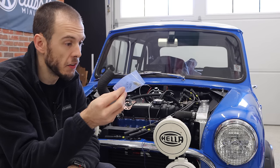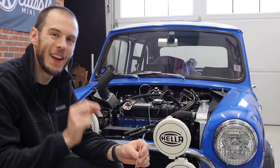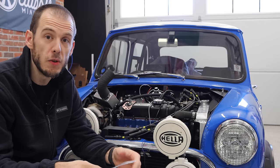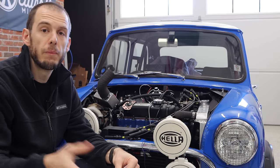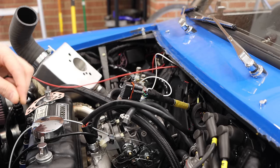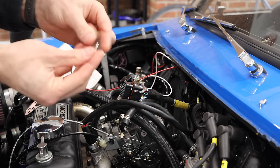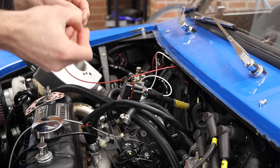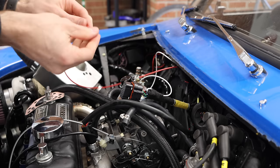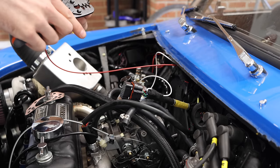I have my new wiring connectors here. Basically, I'm adding a pin in the wiring diagram where it says to add the input from my AEM X-Series gauge into the DTA Fast ECU. This is going to be really different depending on the type of ECU you have — so you'll want to refer to the wiring diagram for yours. It's important to note that repinning or adding a pin to your ECU uses a special style of crimping connector — not the same as what you'd normally see on automotive electronics. You need a special crimping tool made for that style connector, otherwise this is not going to get crimped properly.